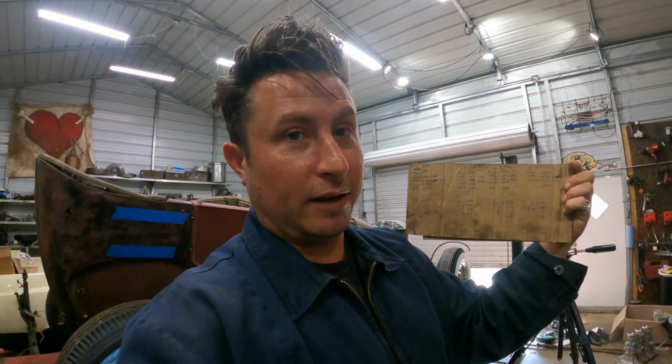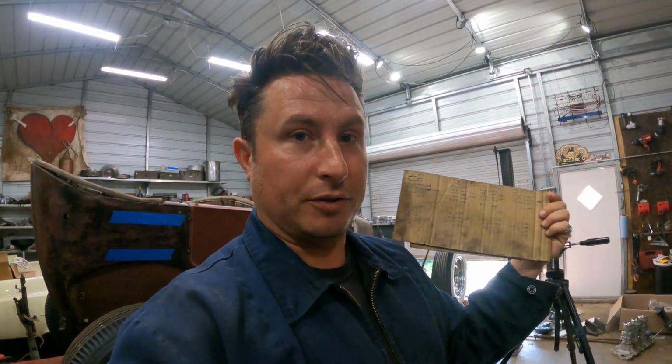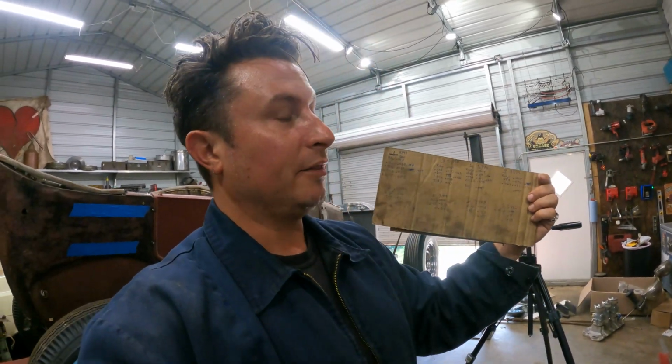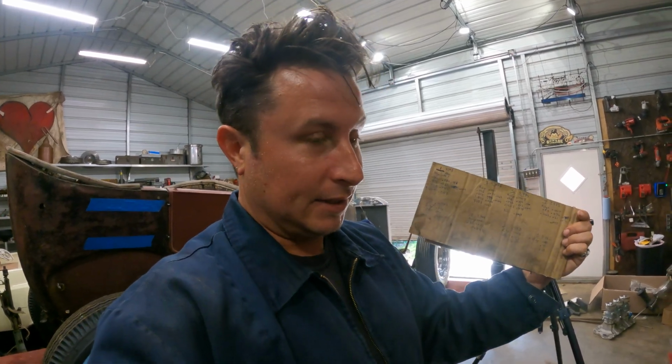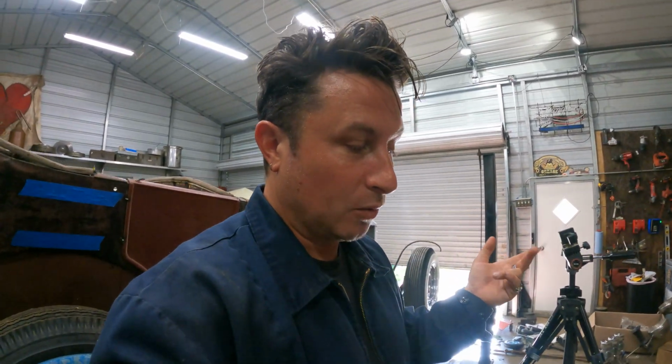The majority of my taper is right at the ridge, meaning there's a ridge where the ring didn't touch at all, and then just below that, there's a very worn part, and then a quarter inch below that, we're sneaking back into 5 thousandths of an inch taper max all the way down. So what are we gonna do?